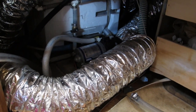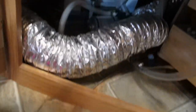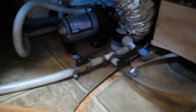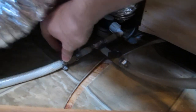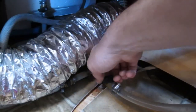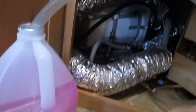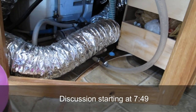This option is where you feed the line coming from your water pump right into your bottle of antifreeze. This is a cool option if you have it or you can add it on. Here's my main line coming in — what I'll do is turn this valve off so instead of the water pump pulling from my water tanks, I turn this valve on and hit the water pump, and it's going to start sucking everything from the antifreeze bottle. Then same thing — turn all your faucets on until you see the pink coming out.